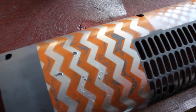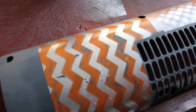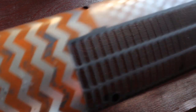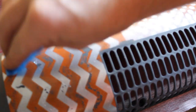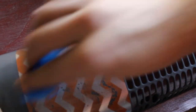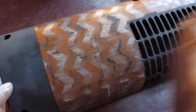A little trick I learned from doing this for a while - if you get to this before the paint's totally dry and it still has a tackiness to it, you can take just some regular painter's tape, the blue stuff. Since this is going to sit on the car with wind moving in this direction, you always want to stay in that mindset of directional. If you kind of rub this over it, see it's taking some of the paint - and that's naturally how wind and sand and dirt will move over the years. Down here where it's kind of soupy, you can just take some sandpaper and that'll give you that battle-worn finish.